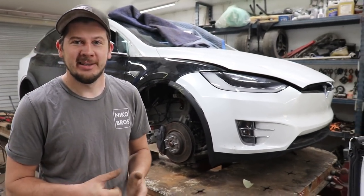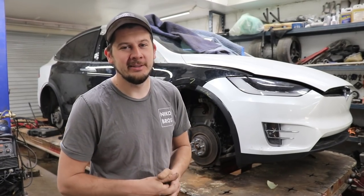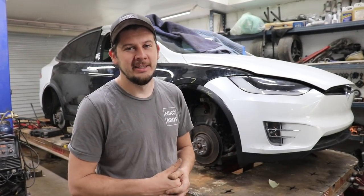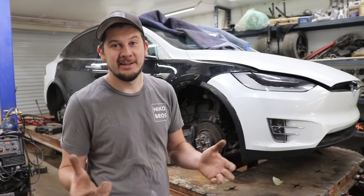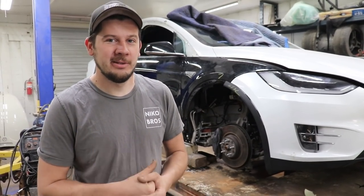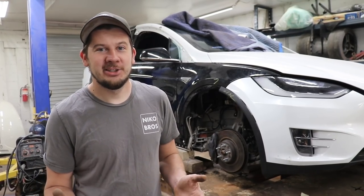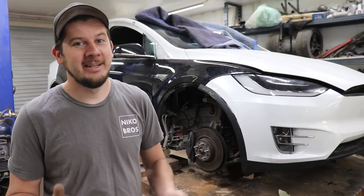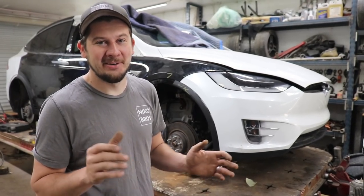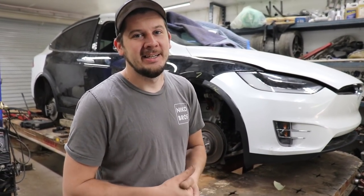But the next thing to do is to take it apart, and we have to finish a little bit of welding because we put some panel bond on it and we can't weld right away. So today we're gonna weld. We're gonna take apart what they kind of did, and after we weld, we're gonna grind, bondo, we're gonna primer, and hopefully we're gonna jam out the fender and the door. We are not gonna take off the back door because the gaps are set pretty good and I don't wanna mess with it again. So pretty much, let's hook up the battery, let's open up the doors, and check out what they did.